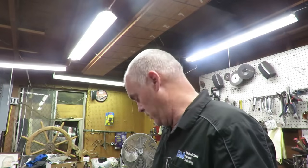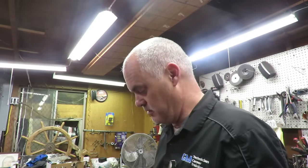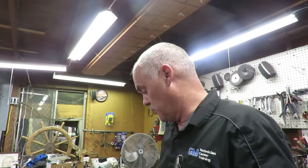Go ahead and spend the money and have a machine shop vat and clean, an acid bath or bake or whatever they have to do to get these parts spotlessly clean. And then you need to final wash everything with soap and water. I've talked to you a lot about that before. All right, so we got our crankshaft in. Now we're going to put our caps on and we can start with our piston and rod assemblies.